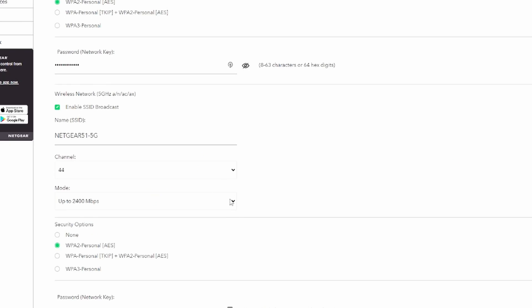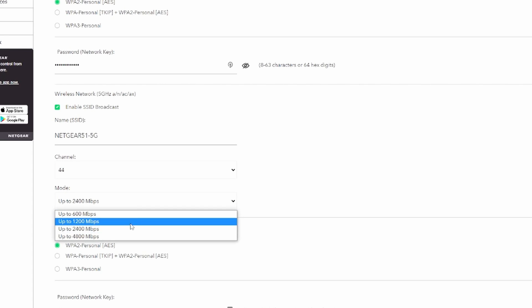Below the channel selector you should also see an option to select a mode or bandwidth restriction for that channel — think of it like a pipeline. The wider the pipe, the more data can be sent, but it also widens your channel, meaning more potential interference. I was lucky enough to find a completely free channel where I could push that bandwidth right up to the maximum. This made a dramatic increase to my performance — I lost the message saying performance could be degraded and had the full potential of my wireless content unleashed. These settings will improve both your wireless VR and your general internet usage.